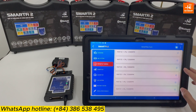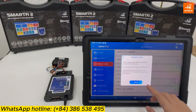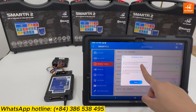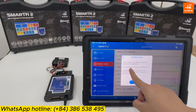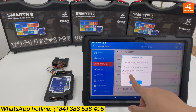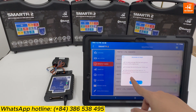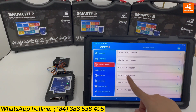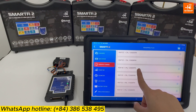You can click the check mark icon to see the meaning of each map. For example, map number 4 increases average fuel and ignition by 4% compared to the original, raises the RPM limit up to 12,000 RPM, and adjusts the AF ratio to handle fuel shortage or excessive fuel consumption. I will select that map.